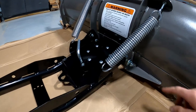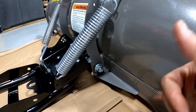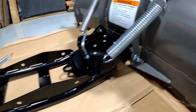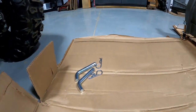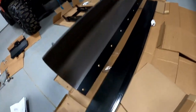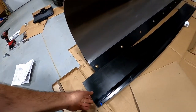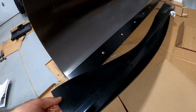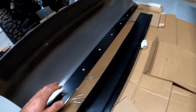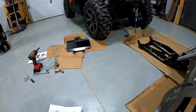At this point we have our trip springs fully set, our adjuster bolt that determines the angle of the blade, and it's all mounted to the push tube. We've got our pins that we're going to use to mount to the vehicle. The last thing I want to mention — all side-by-side plows come with a flap that goes in the top of the blade. This is super simple to install and we'll do it last. It comes with a metal rod and the bolts in this bag — just lay it up, line it up, and put the bolts in. We'll do the mount first.